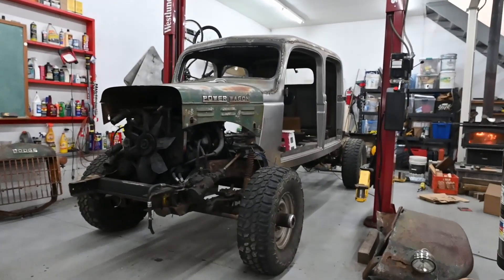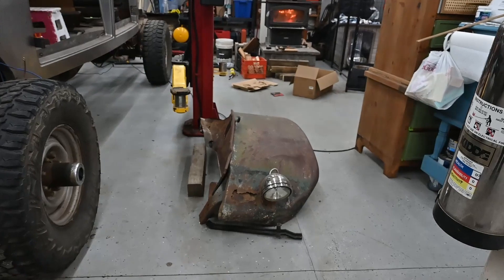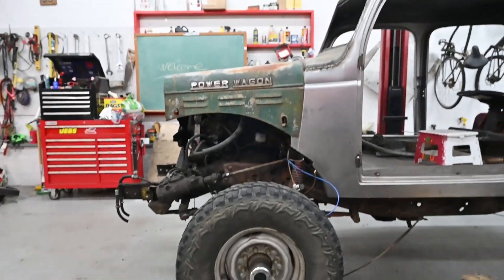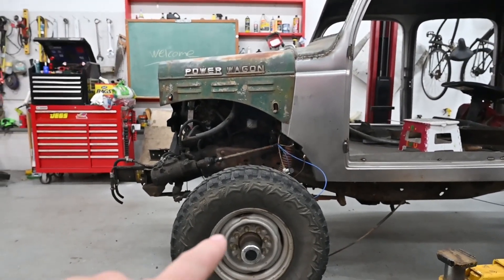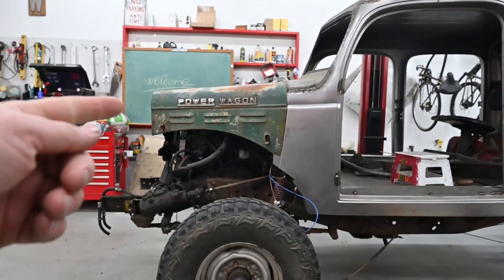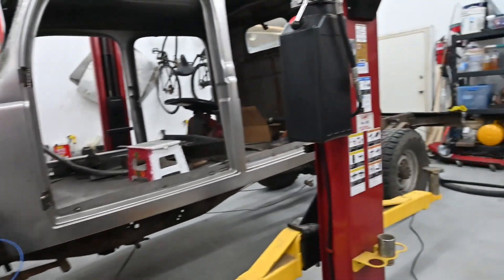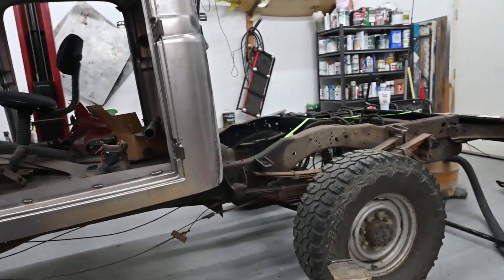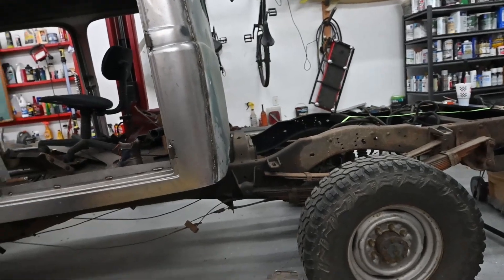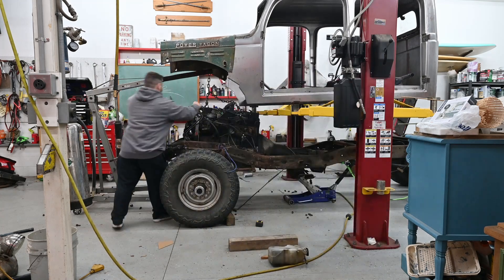Here's the truck. Right now I'm thinking of working on the fenders right there, trying to mount them. But if I put the fenders on right now the tires are too far back, so it's either I got to move the front axle forward or slide the whole body back. But if I slide the body back too far then we get too close to the tire. I might extend the frame anyway to get a longer bed, but for right now I kind of want to leave it to have a short wheelbase, so I decided to work on the body instead.